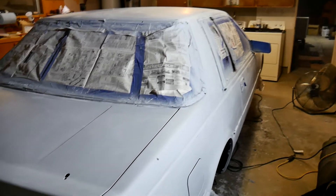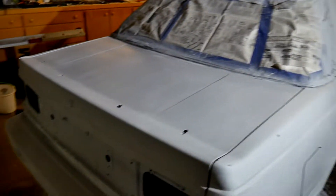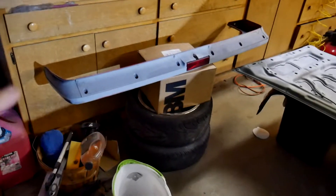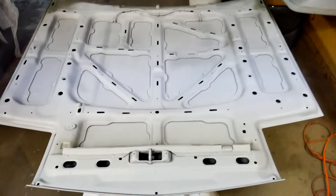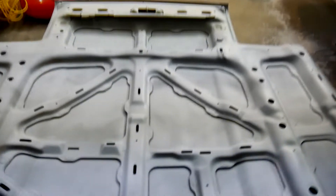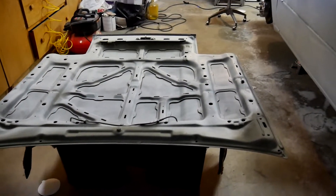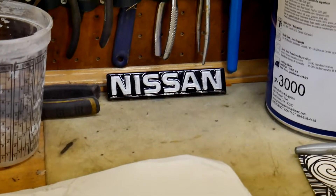For the rack, I also need new lower ball joints. Wet sanding is complete — that was a nightmare, but it's going to be worth it. The actual chassis is ready for base coat now. Now I have to primer all this. I'm going to JB weld some bolts right there for studs. I want to do some cool stuff with the bottom of the hood. The procedure I'm having trouble with is figuring out when to paint it, because I need to do the top of the hood too. I think I'll just do the bottom of the hood — base coat, do the thing I'm going to do, then clear coat it before I even start on the other side. I've got to prep this and the wing, and that came out actually hella good.